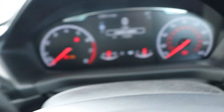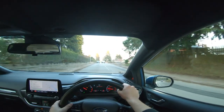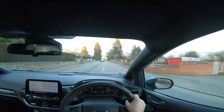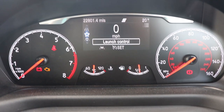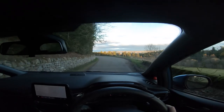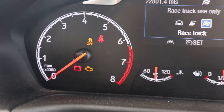Finally, let's talk about the drive modes. The car has three main drive modes. Normal mode has traction and stability control fully on, the exhaust valve closed, cylinder deactivation active — nice sensible driving. Sport mode amps things up: torque vectoring by braking and traction/stability control are still on, the exhaust opens up, and the steering gets heavier so it feels sportier.